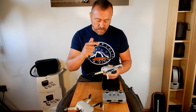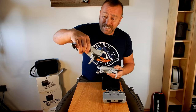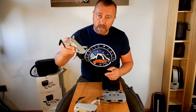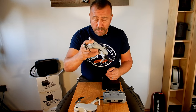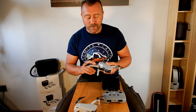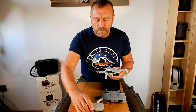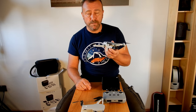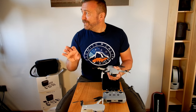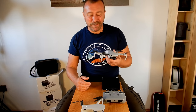I have got high hopes for the Mini 2's ability to handle wind. The pitch has also been increased. The original Mini used to be pitched out at 30 degrees - that was how steep it could fly into a wind. The new Mini 2 can go to 40 degrees, which is going to allow a much steeper pitch and you should be able to get into strong wind far better. The other big aspect is the increase in overall top speed - 29 miles an hour was the top speed in sports mode, it's gone up to 36 miles per hour. So that's another significant increase. Still a lovely, beautiful sunny day this morning, so I'm going to get out there flying later on. Next big storm that hits the UK, I'll be putting this through its paces in the wind.